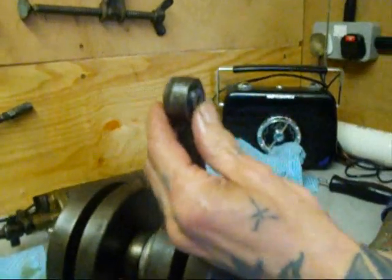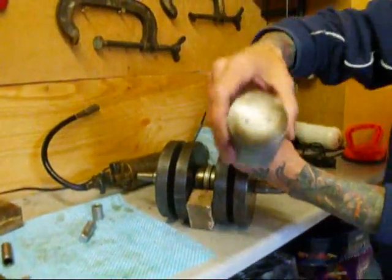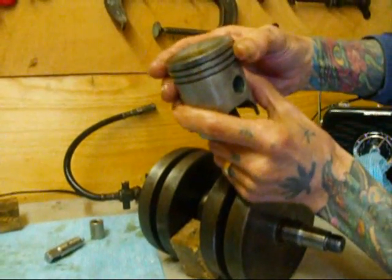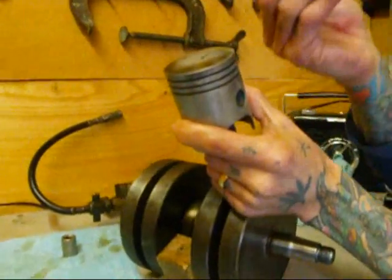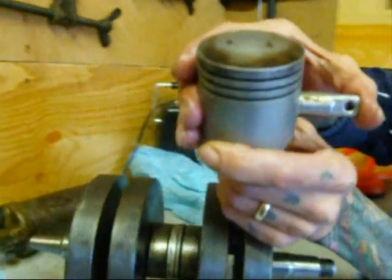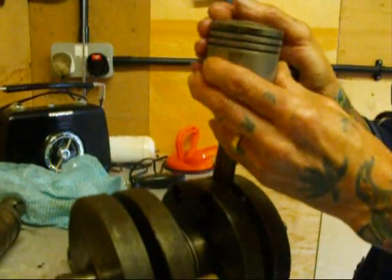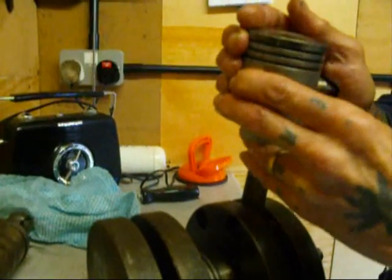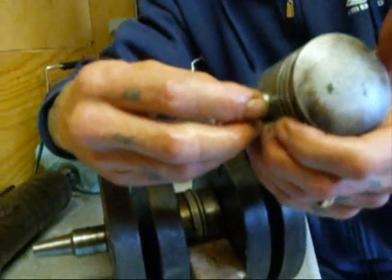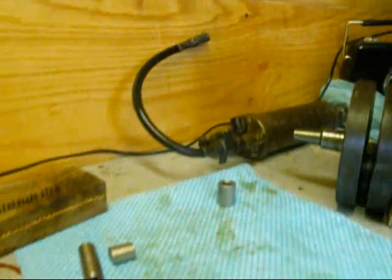Nice. Right, so now we've got to put the piston on. Arrow facing down, that way. All we have to do is put it in place, line it up, and get the second part of the tool with the grease nipple on. We just push it through, line it up, and it'll come through the other side. Just push it in, line it up, and then move it around and it'll go straight through. So now the first part of the tool, which I was assembling the loose rollers on, is out. It's all assembled in there.